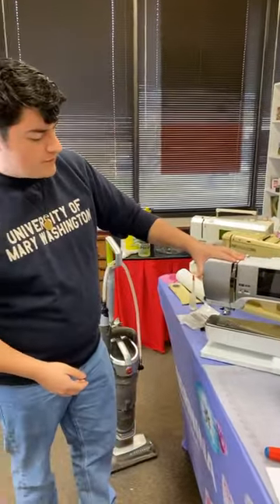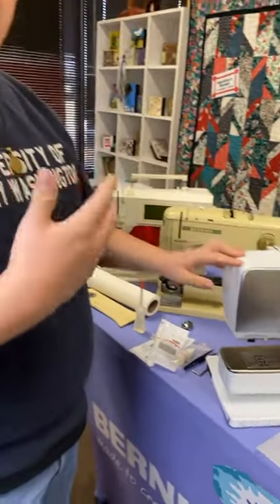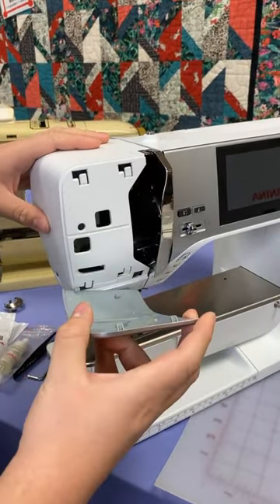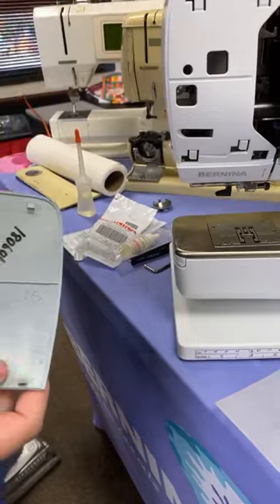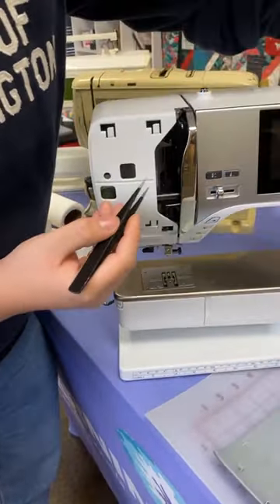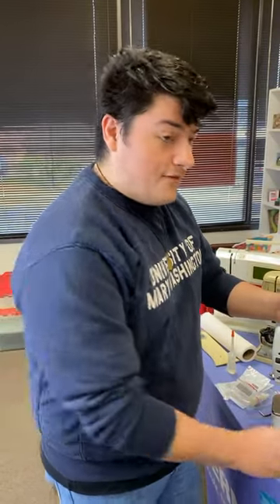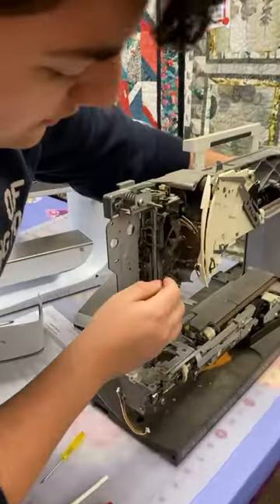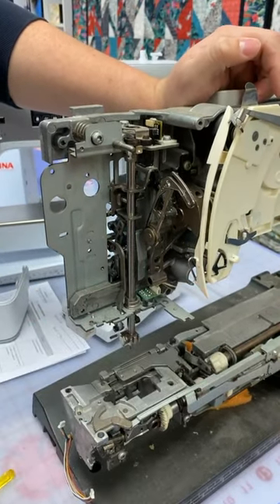On the 4 and 5 Series machines where there's no screw on the side and it has the integrated thread cutter unit, since there's no screw to take off the head cover, what you do is push this face plate — it just pops off. It has little brackets that line up with four holes. Once again, you have full access to the take-up lever. If your thread breaks, you need to make sure you get it all out instead of continuing to sew, because if that broken thread stays in the machine while it's moving at speed, the thread can wrap around the linkages and jam up your machine, causing a much bigger problem.